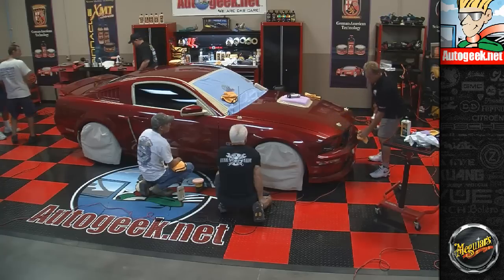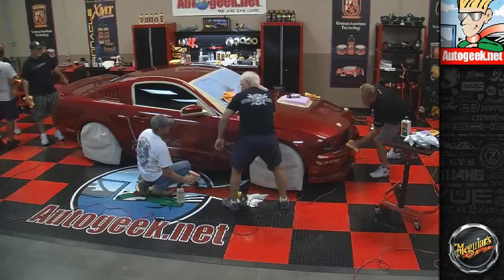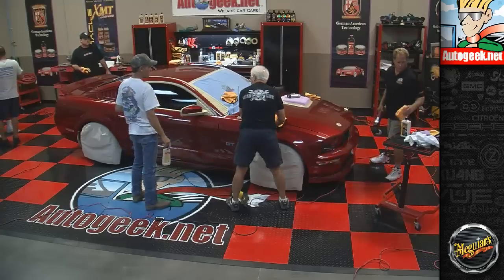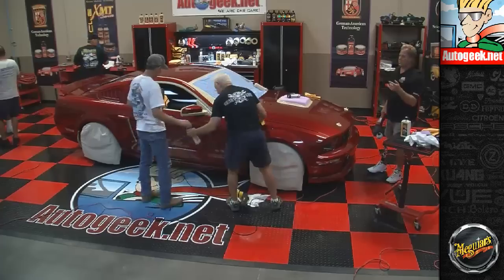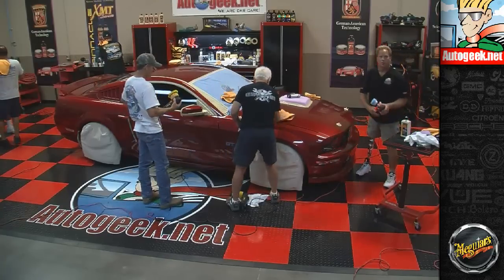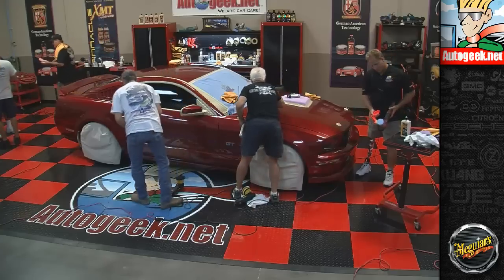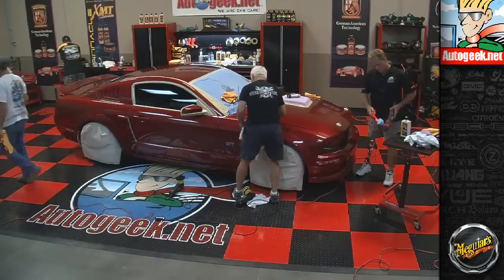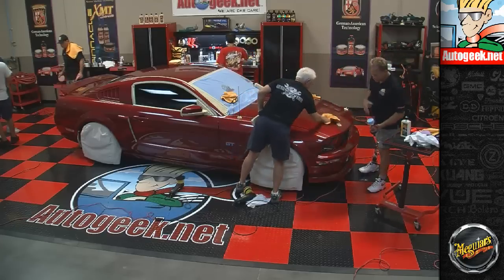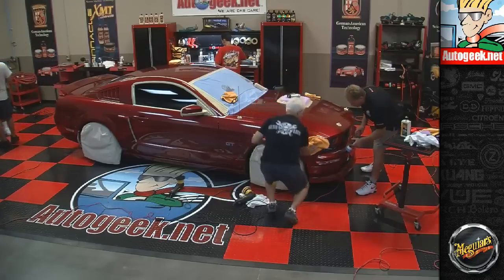How are we doing, guys? We just about got this all buffed with the 105. Okay. Let's go ahead, when you get done with all the 105 steps, let's put the orange pads back there in the dirty towel bin, and let's switch over to the white polishing pads and get the M205 ready to go. This is just something most guys don't do, is clean their pads often enough, you know. But you'll find the residue always wipes off easier if you remove the spent residue before working with fresh product.